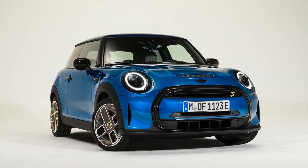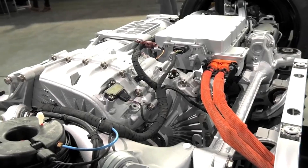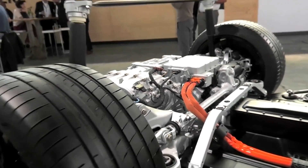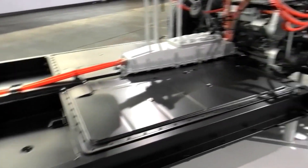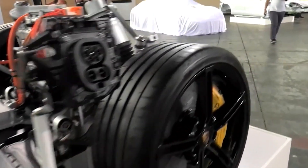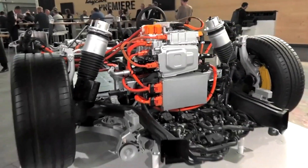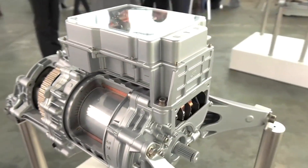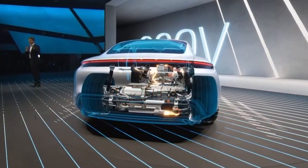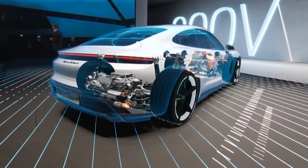But should we use them? No. The energy that powers the alternator is actually the mechanical energy created by the motor. The motor uses electricity in order to spin the drive shaft and turn the wheels. If you are running an alternator off of the motor, we are using electricity to make electricity. Because you are turning the wheels as well as the alternator, you will be using way more power than you would be able to generate. Plus, you'll be adding another failure point to the car, which will mean more maintenance and more headaches and more money.